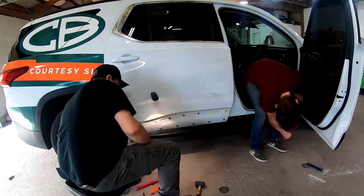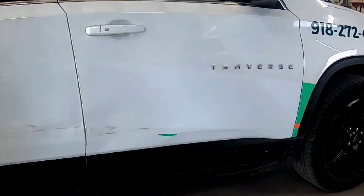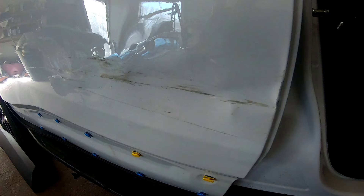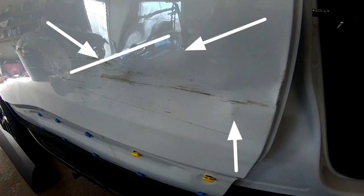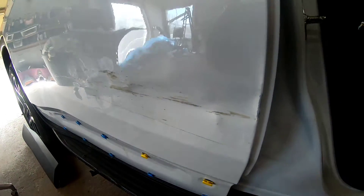The first thing I want to do is remove the trim and the decal and get a good look at the damage, because I'm still undecided whether I want to replace or repair these. Taking a look at the impact on this rear door, I can see that the front edge has been pushed in. It also has created a crease right down the center of this door, and by doing that, it's created some crowns and high areas around that crease. I'll use different techniques to pull that crease out and tap down those high areas around this damage.